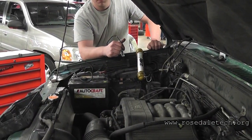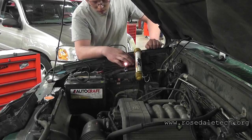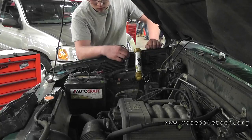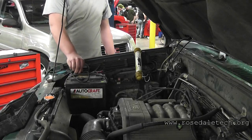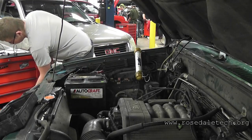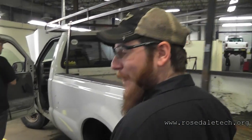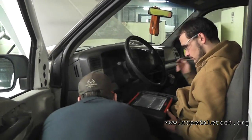So you only have one that's hot all the time. Let off crank and check them all again — check the one that was hot. It's dim too. Is the battery dead? Turn your headlights on for a second. We need a battery charger on this. Give me a battery voltage reading. You got your voltmeter? These lights look dim — I think we need a charger.